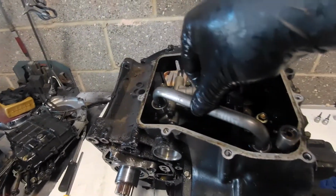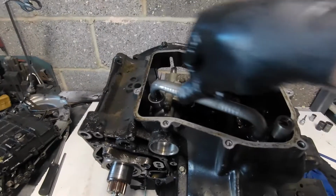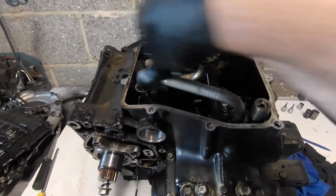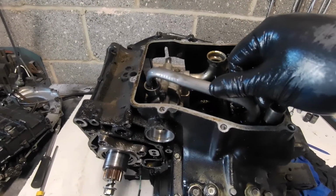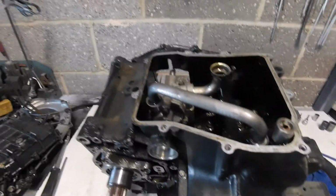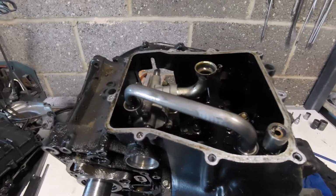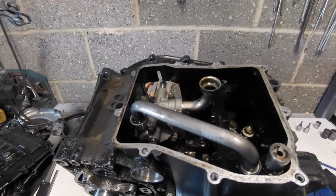It's a pressurised outlet now, so we've got oil pressure in here. Pressure is ungoverned at this point. It's, what's the word, exponential with engine speed. If you think about it, from tick over, say 1,000 revs ticking over, it's got to create enough oil pressure to keep it safe, all the way up to, what's this thing go up to, 11,000 revs or whatever.